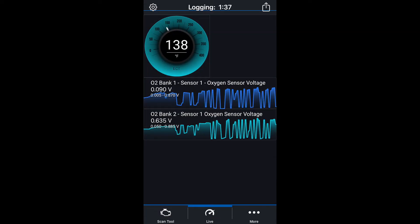Look what happened — everything's working just fine. I'm getting the readings. This is what you want to see from your O2 sensors. The green is from the passenger side, the right side. The sensor is going to go between 0.1 and 0.9 essentially, and it's a constant back and forth. If you're not getting anything, it's usually stuck around 0.450 or 0.5, or just dead. But that's exactly what you want to see — oscillating back and forth, going high, low, high, low. The engine is constantly making adjustments, injecting more fuel into the system based on these readings.